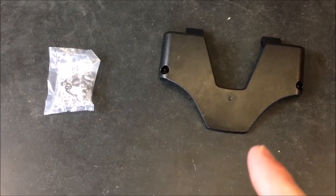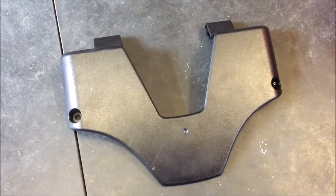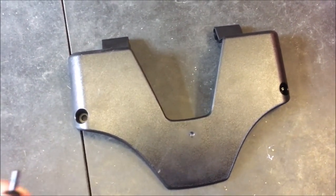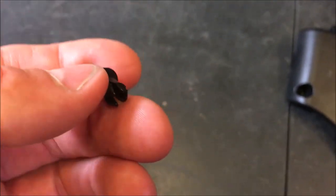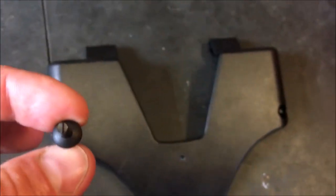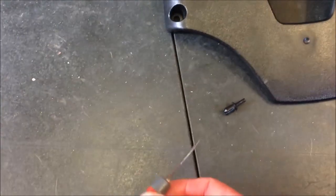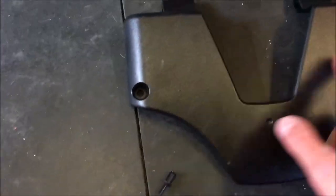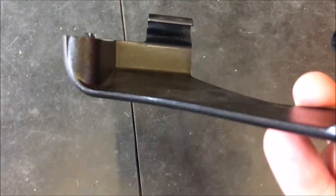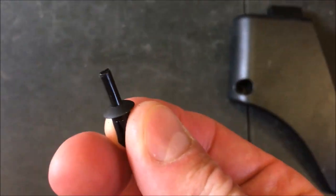Here's a couple of extra bits just to make the video worthwhile. Here's the document holder — I'll tell you how you remove it. The document holder sits underneath the driver's side of the car, and if like me you wanted to remove it to gain a bit of space, it's a very easy thing to do. It's held in by these pins which press through this plug and clamp. To remove it without damage, don't rip it off — all you need to do is push these all the way through using essentially a punch, so it pops out the other side. You can collect the little part from inside the dash, and once you pop those two off, it just slides off the back of the dash casing. Be careful and you can push it straight through, collect the pieces as they pop out the top, and save them to reinstall at any point with zero damage.